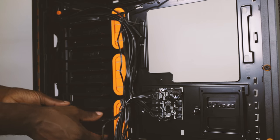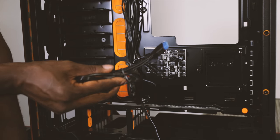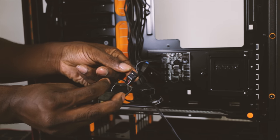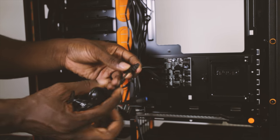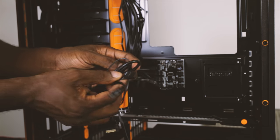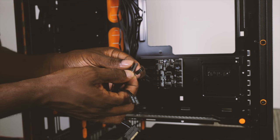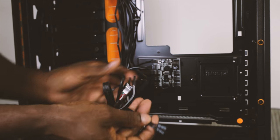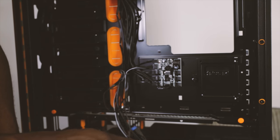And I like what they've done here. They've given us flat USB 3 cables, which is especially good for the new upcoming motherboards. I'm definitely proud of that. Still got spaghetti junction with HD audio, but this is nicely cabled and nicely wrapped. This is a SATA cable for power, and then USB 2, which has got spaghetti junction cables, and then you've got your minus and plus LED, the HDD LED, and then your power switch and the reset switch as normal. Nice flat cables, easy to route, nice and long, decent.